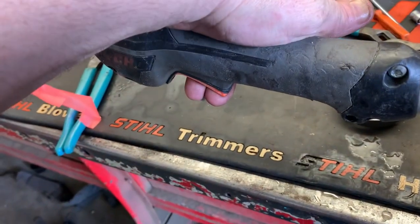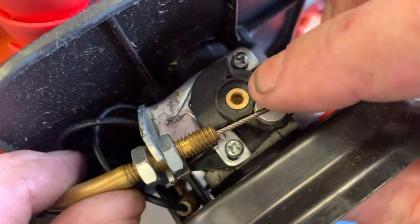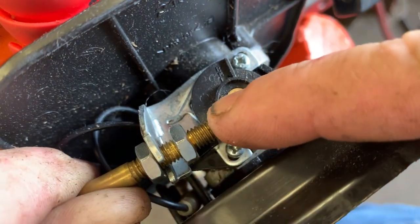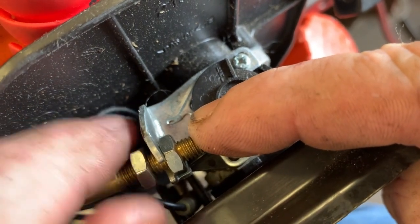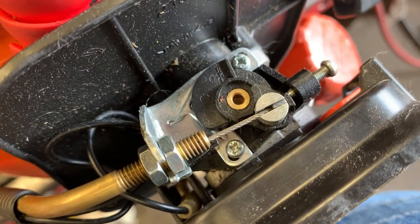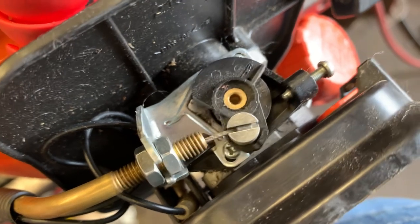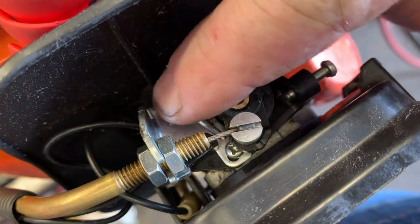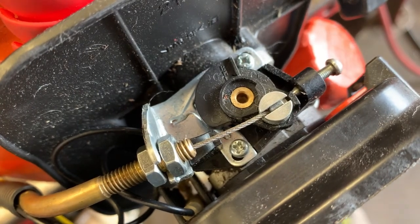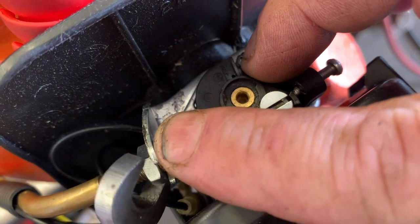You can tell I'm at almost wide open throttle and I'm barely moving the carburetor. It's pretty straightforward — if we want to tighten the cable, we move the cable back and then tighten up the jam nut. Hand tighten it for now, then check your throttle for full range of motion. In the barrel you want about a sixteenth of an inch of play. We're still not at wide open throttle — there we go, wide open throttle right there. At that point, just cinch down your nuts and you're good to go.